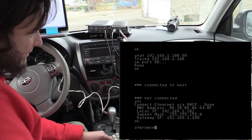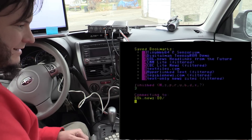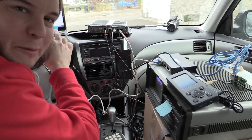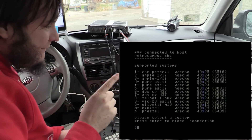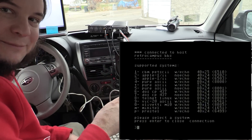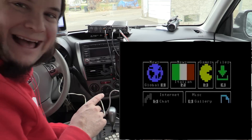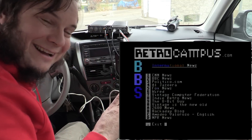I'm just going to try AT browse. Let's try 68k news — that worked before. It's failed. Things are looking more promising now — it's actually trying to connect and we have network traffic. We're still having some issues and I keep trying to set up a PDP context with more data but it always defaults to background. It's working! It's finally working — we have a connection! I had to go out of the browser, go back into terminal mode, and do ATDT BBS retrocampus.com, and it looks like we are connected to the retrocampus BBS. Finally! We finally have the Commodore 64 on the internet with the satellite modem. We have our retrocampus home page!